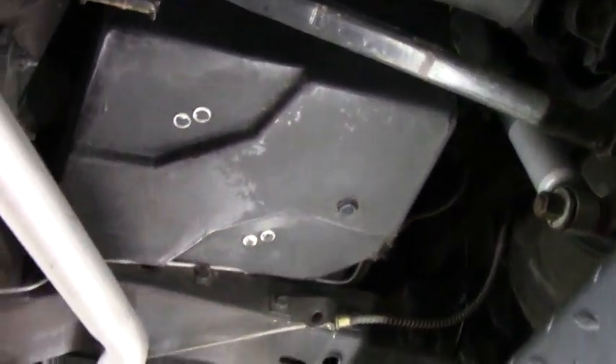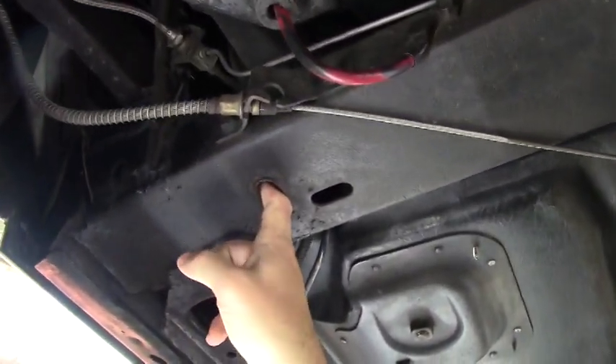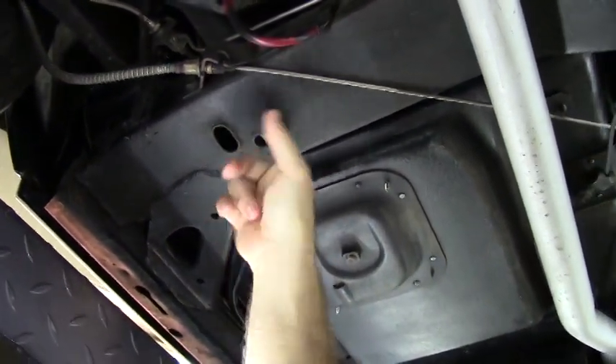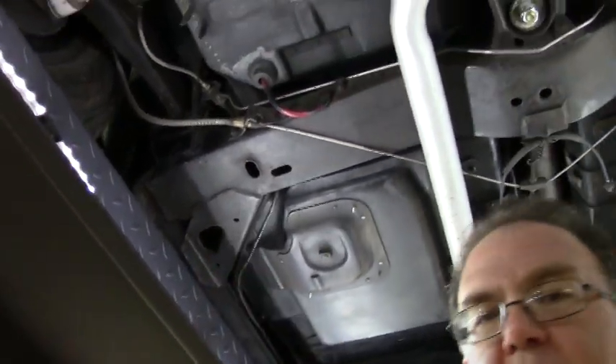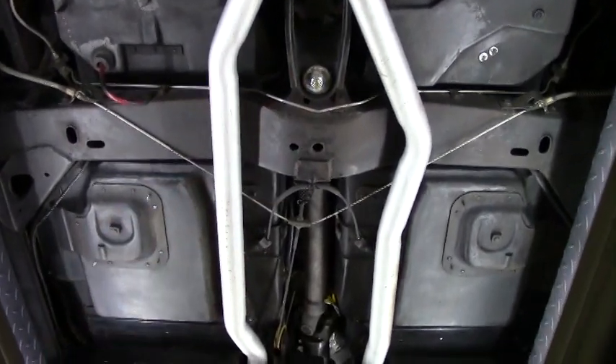And that leads me to this frame — this frame is beautiful, just in great shape. If you're ever looking at a car underneath, you want to run your finger around these areas because you want to make sure there's no rust or corrosion coming out of the car. The torque cushion bushings look brand new on this car.